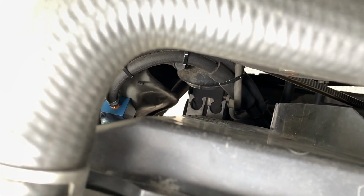Very important when you modify the cooling system on these to keep the fan shroud intact. The fan cannot pull air through the core if it is just open. Colossal waste. And I don't know if this is in Japan only, but a lot of the Australian guys in their shroud, they got a divider, so really it's only pulling from part of the radiator, some big hole over on this side. The one from Japan does not have that. It actually pulls from the entire radiator.